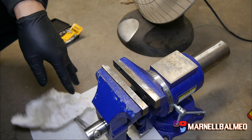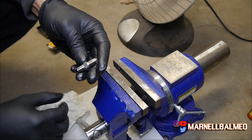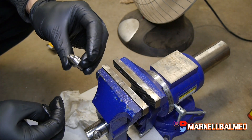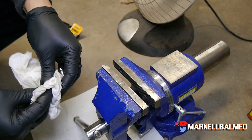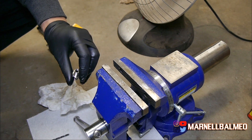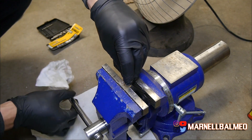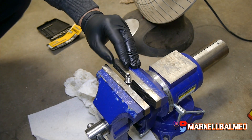It might be too late, but I'll open it up anyway just in case. For those wondering why I ran a restrictor at all — I have a ported oil pump, so I wasn't sure if I'd need one. I should have just verified the pressure earlier, but the car wasn't fully running and drivable at the time. So I'm going to open this up all the way — essentially straight 4AN into the turbo. I'll drill it out from the top to make sure it's centered. This is stainless steel, not aluminum.